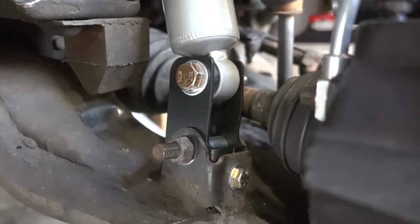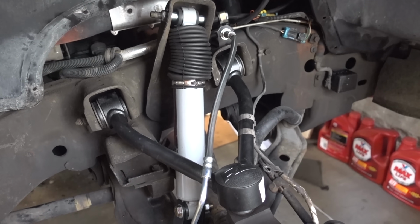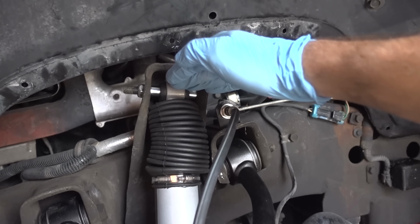So why was this happening? Well, I have a theory, and that is that I was using the 2-inch shock extensions included with the Rough Country lift kit, as well as the Rough Country shocks. Now, these front Rough Country shocks are indeed made for the lift, and therefore were already 2 inches taller than my stock shocks. So using a shock that was already 2 inches longer and a 2-inch extension on the lower control arm meant that these shocks were compressed way too much in the normal ride height to really be that effective.